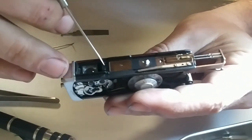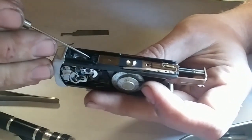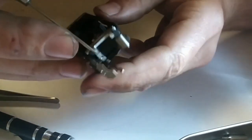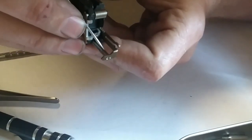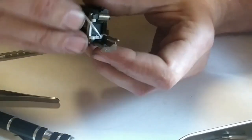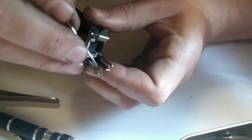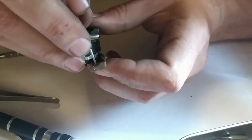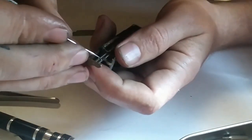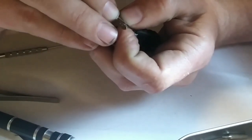Because this end's open, and this end's open. I took out the little viewfinder lens cover here — just a piece of glass — and lifted that out to keep it out of the way. I just unhooked one of the tiny little shutter springs on this end by taking this pick here, grabbing the very end of the spring on the bottom side, away from the back side of the camera, and poking into the hole to gently tickle that end out. Because the springs look like they're okay; I don't know if they'll survive this taking apart, but if I can manage to save them, it's one less thing that I have to get.